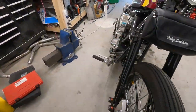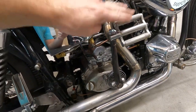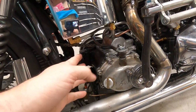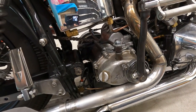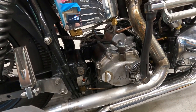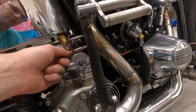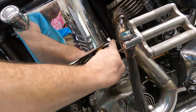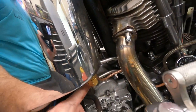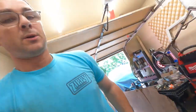The other thing I did last week was switch out the lines. I had those copper lines on here — you'll notice there's no more oil filter. We have about 500 miles on this motor, so if it's gonna chew some metal up it'll do it during that time. A lot cleaner, a lot less clutter. Built these stainless lines — they run all up and I've got rubber up top so we don't have cracking issues. They tuck in a lot nicer than the copper ones, and removing that oil filter helped a lot. The only piece of copper I still have is this vent line because I didn't have any quarter-inch stainless tubing.